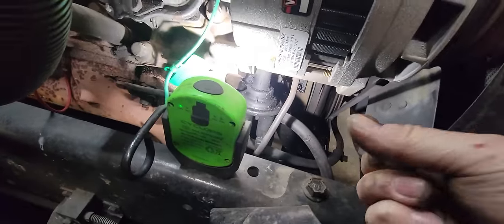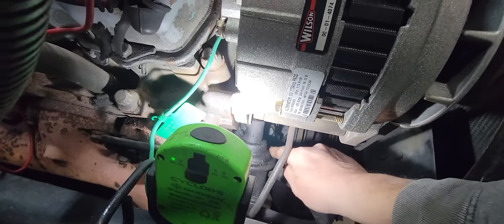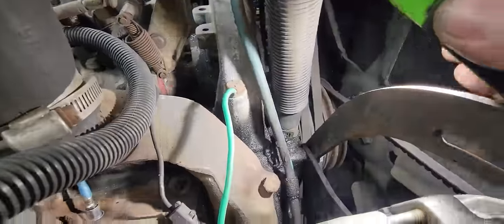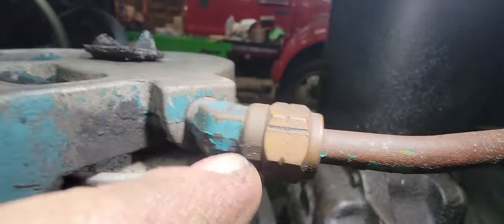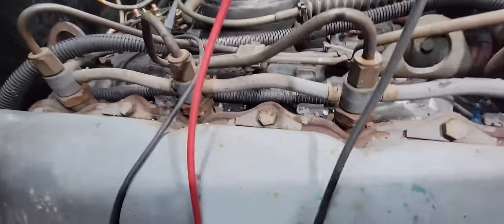Smells like diesel fuel. So there's our first leak. It's getting wet right there. All right, we'll keep looking, but that's one of our spots. And we have a line, and any place like this where there's a holder, you want to pay attention to as well, because that line could be rubbing through that holder. So I don't think that's the case there, but we'll follow the line up, and then we'll definitely tighten up these, either a rubber fitting under here. And then we'll just go over the whole entire system, looking for anywhere it's damp.